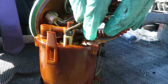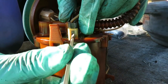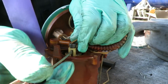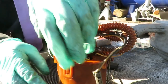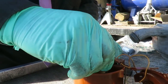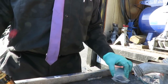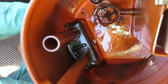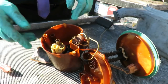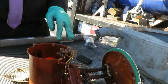Before we pull the cover up, we're going to unplug our fuel pump. You need a small flat screwdriver or something really small to go right inside that little groove because there's a little tab in there — push that in and then unplug it. Just like that. Now carefully pick our fuel pump up and put that to the side. Look at this — it's got two socks. Look at all this dirt inside of there too. I'm going to get a carburetor cleaner and we're going to clean this out.